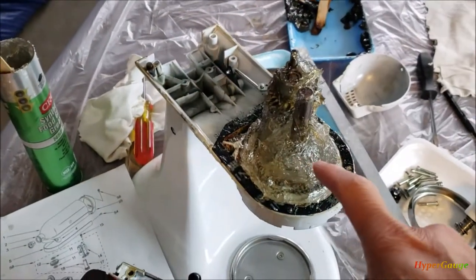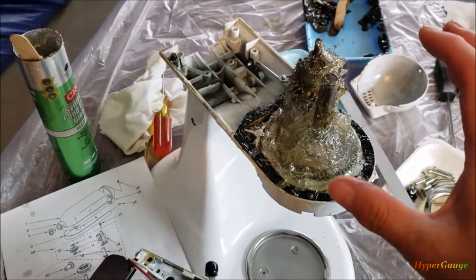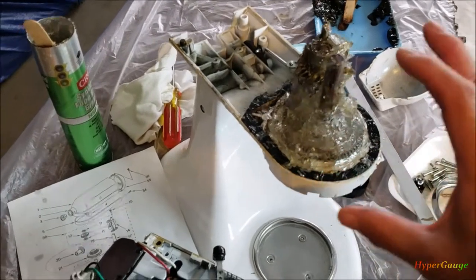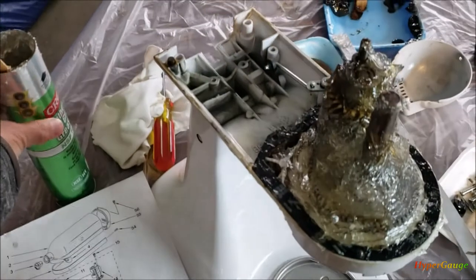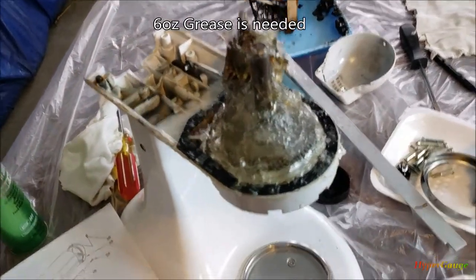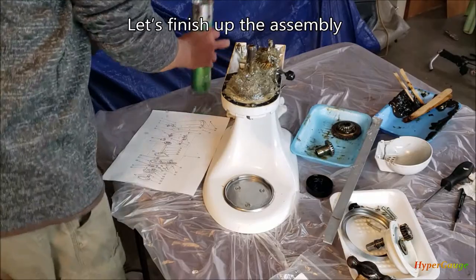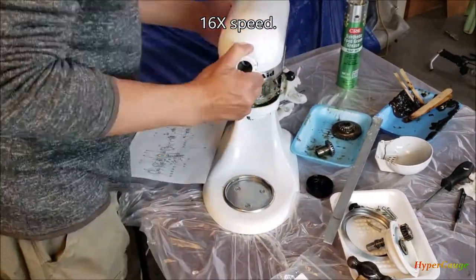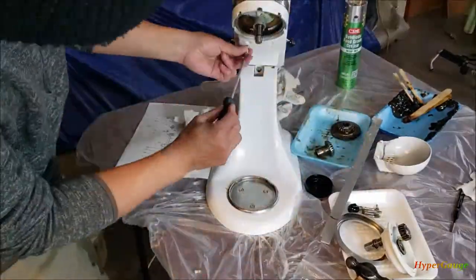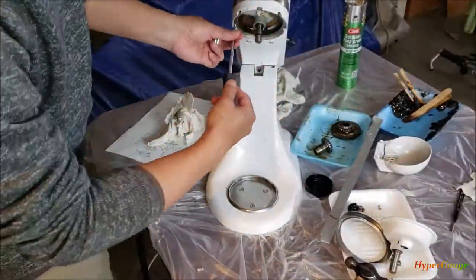All right, so putting back the gear is not that difficult. I couldn't find any proper instruction on how to put the grease on, so I'm basically using both hands — you put some grease on and then spin the gear so every crack gets filled with grease. This is a 14-ounce tube and about half of it was used, so it's definitely more than 6 ounces on both sides. The entire disassembly and assembly process is not difficult, as I had watched some instructional videos a few times and pretty much memorized the whole process. If you're interested, you can find the link to those videos in the description below.